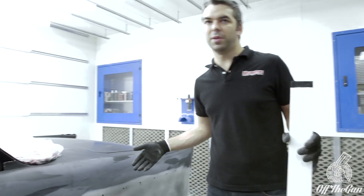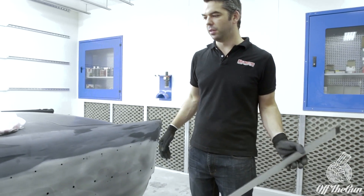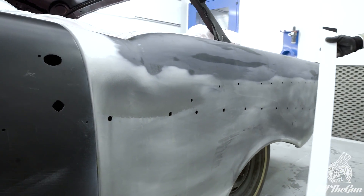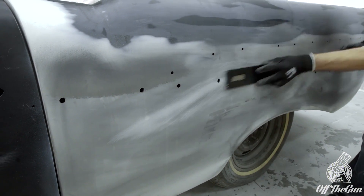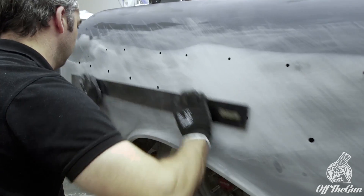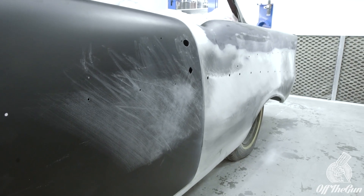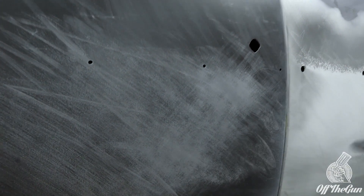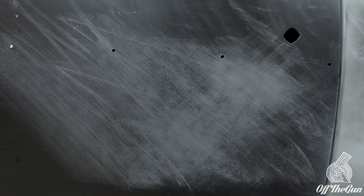So we're back on this '57 coupe. We've been through a bit of a process with our metal filler; now we're getting close to paint. We're going to use the spline for a bit of a rub down on the rear quarter just to make sure it's all nice. It's halfway through some work — we've got a guide coat thrown on, some sticky sandpaper on one of the splines, and we'll give it a rub and see how it looks. We've spent about two or three minutes quickly rubbing it with the spline. You can see where the spline's bridged across the gap, hit this area of the door and hit the rear quarter — there's a definite low area in there that'll cause the reflection in the body side to roll into that shut line. We can either live with it or correct it and make that run through for that show car look.